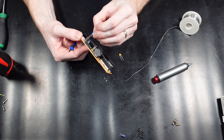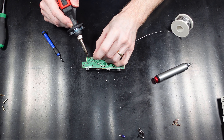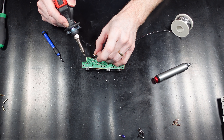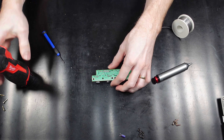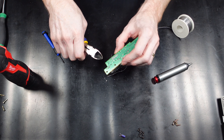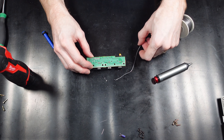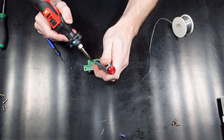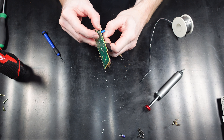The main reason for doing this modification is because the Sega Dreamcast has a fixed battery inside. When this battery becomes dead, every time you turn the Dreamcast on you'll get a message asking you to put the date and time in. By putting in this modification it will allow the battery to be replaced once it's dead. This small kit was actually purchased from a seller on eBay — I just looked up 'Dreamcast battery' and this one came up. It cost less than £3 including shipping in the UK.